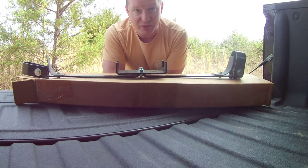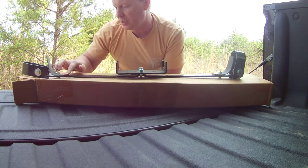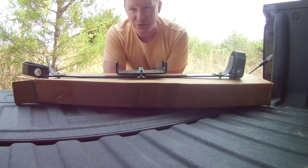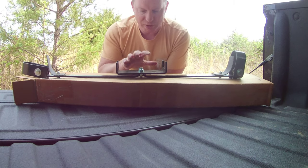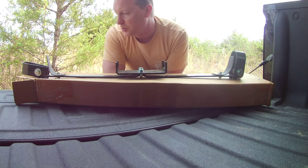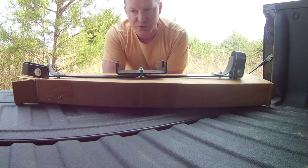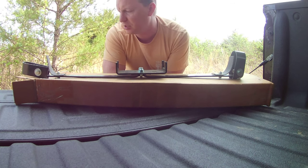It's probably a good idea for anybody that's souped up their bug to have one of these on. This only applies to the older IRS or swing axle types. The IRS cars handle good from the factory, but the swing axle — if you're going to do any kind of high-speed driving, you want one of these. It helps with stability. We've already got a souped-up motor and the car's a little twitchy, so this will really help the stability and improve the suspension and handling of the car.